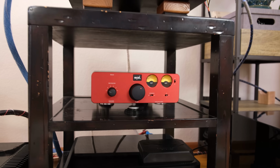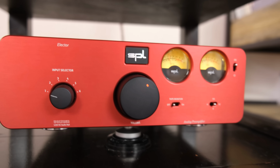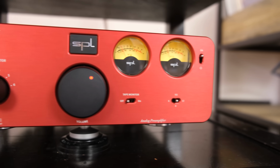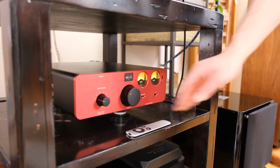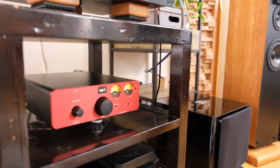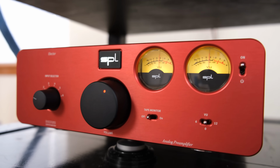Perhaps my favorite feature of this little beauty from Germany is the way it can pair with just about any remote control out there. I grabbed my unused old Apple TV remote from the basement, pressed the white button on the back panel of the pre, pressed the down button on the remote while aiming the remote at the meters until the volume knob's LED blinked 4 times, pressed the up button repeatedly the same way, and in about 20 seconds I had a rock-solid connection to the volume control of the preamplifier from my listening position about 10 feet away.